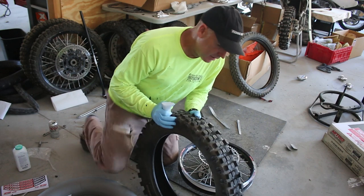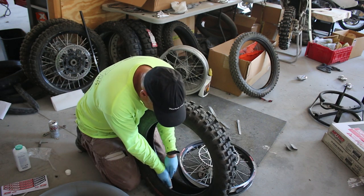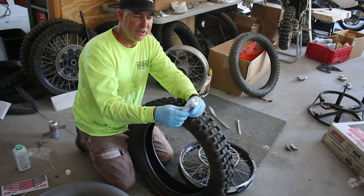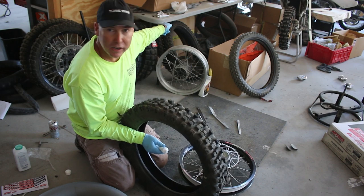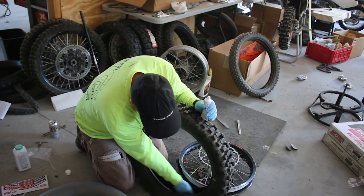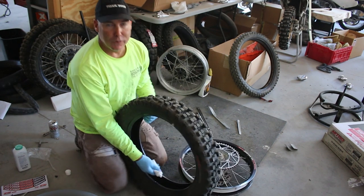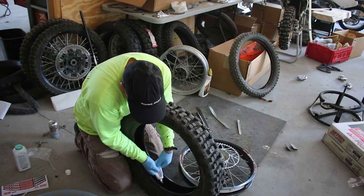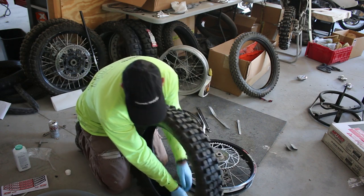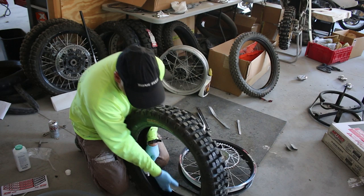Here's my tire. It's been in a stash stack so it'll be interesting. I take my lube and put it in the center of the tire, then spread it around. For a rear tire, a single tube generally isn't enough, so I add another one — especially for a fat rear tire like this. The Equilibrium is a 450 by 18. I put a big fat bead down in the center, then spread it out, and I'll come around a second time to make sure it gets up on the sidewalls, because the spinning rotation of the tire will send it out to the outside.